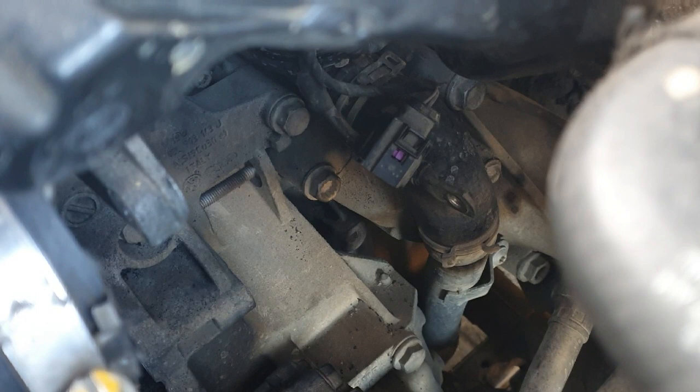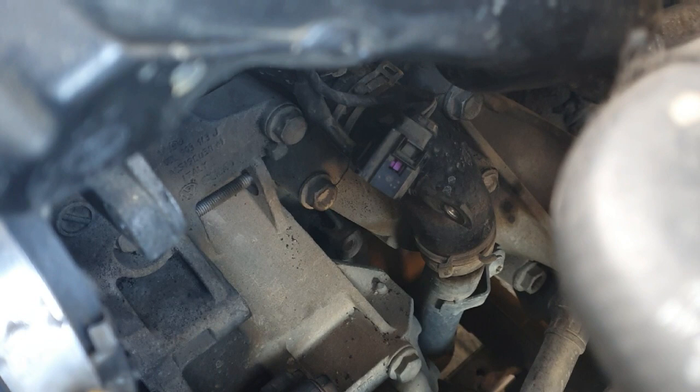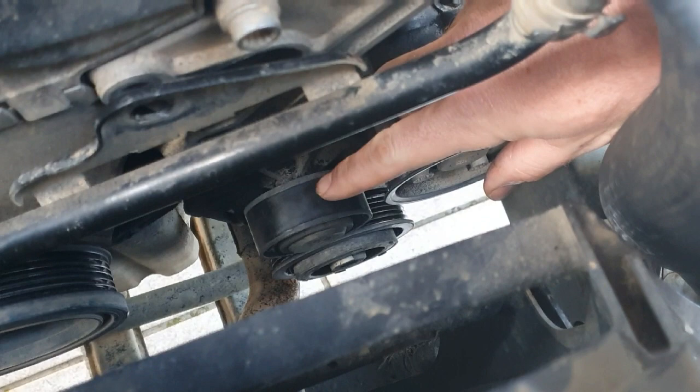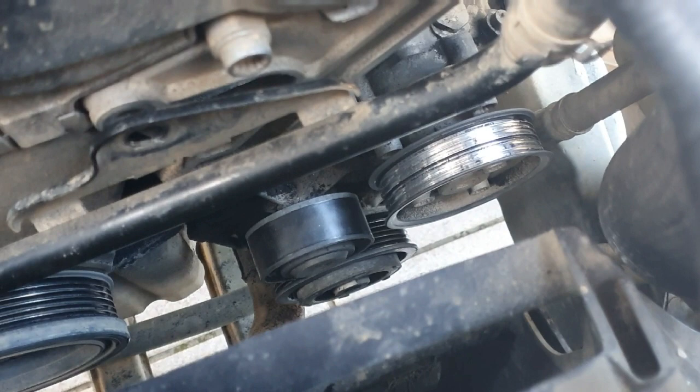What I normally do, because I can't get a torque wrench in there, is first do the tensioner on this side, then torque the front bolt up to 20 Newton meters and feel the tension with your spanner. By feeling that tension you can get quite close to it by tightening the one at the back immediately after, then rotate both the front and back bolts further.